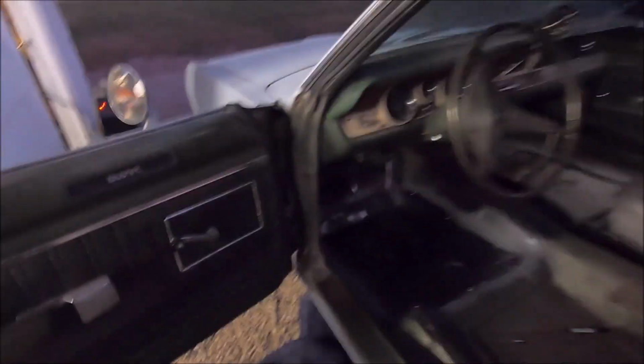Alrighty, just gonna show you this. This is where I'm gonna end off for the night. I got the panel tech screwed in here, including one tech screw that goes to the front frame stub, so that way it's tight. So I'm gonna take this back out, which I'm gonna regret. Prime it both front and back, let it cure overnight.